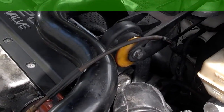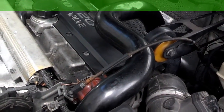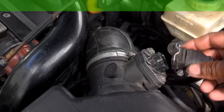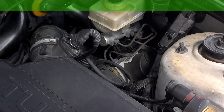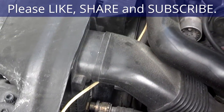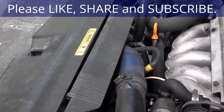We put a used poly mount there, we got the new mount there, got all that stuff back in place. We got the throttle cable back over the turbo tube — it had gotten tucked. Getting ready to plug in this mass airflow sensor. Now we're going to take the ABS module out for repairs. I'm not sure if this vehicle has TRACS — I don't think it does — so we'll probably have to ship this in for repairs. Looks like it had a radiator replaced, so we're going to tuck the fan shroud and relays back the way they're supposed to be.